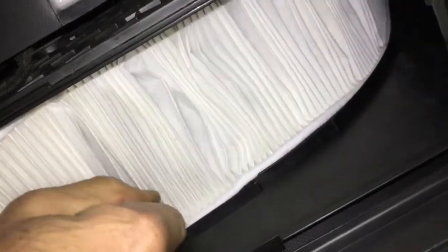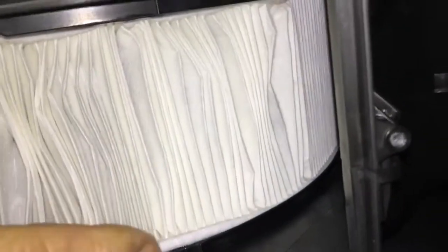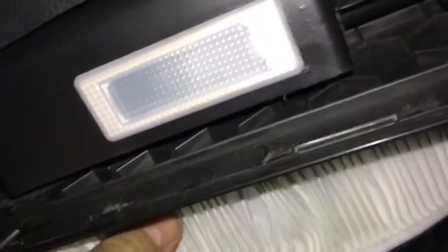Actually, I'm not very pleased with that. Being an aftermarket filter, it doesn't go in as well as the genuine ones, and as a result it's crunched up in a few places despite a lot of effort trying to straighten it out. You have to make sure it goes right to the end at the top because you don't want any air gaps - similarly at the bottom. But because it's crunched up, there's a bit of a bypass air gap where the air can bypass straight past the filter. So I'm not going to use that one - pulling it out. You can see how poorly it fits.